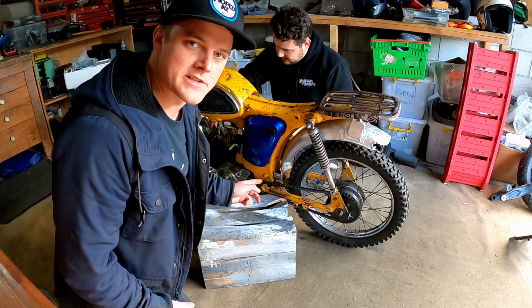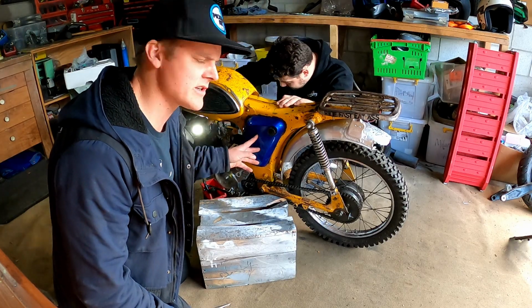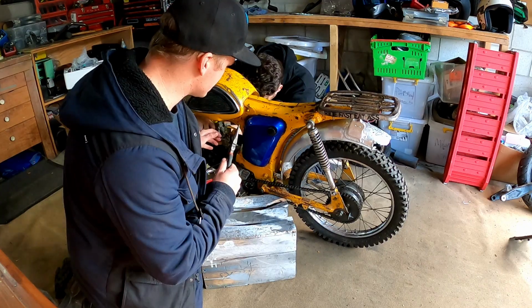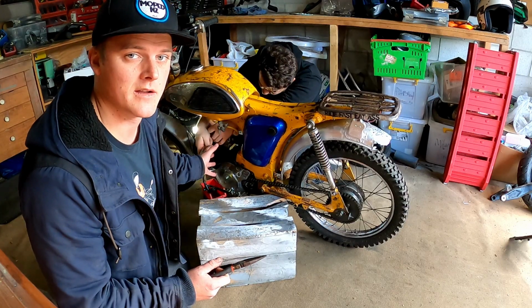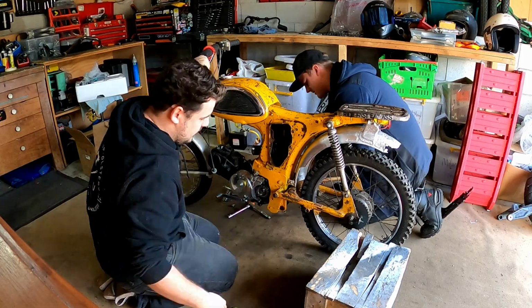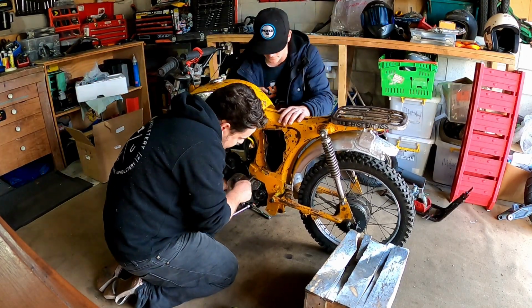So we just got to do a couple of things. Remove the chain. The wiring goes inside the frame, so we're going to disconnect the wiring. Remove the side cover to do so, I believe. And once the chain's unclipped, which I'll do now, we can just undo 2 engine bolts. Andrew's removing the carburetor at the moment. And yeah, there's not much to it. It's literally held in by 2 bolts. Actually, lean it on me and I can still get to the engine.